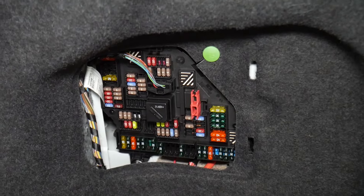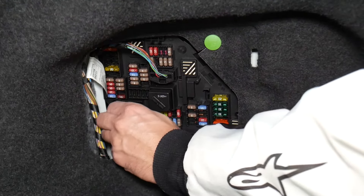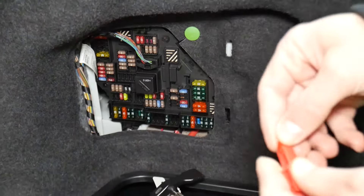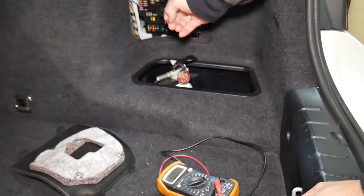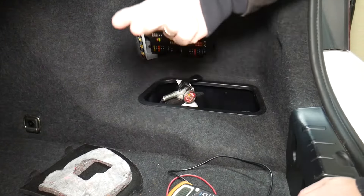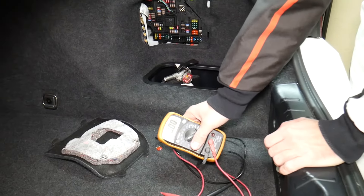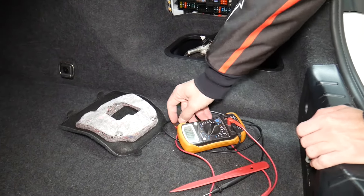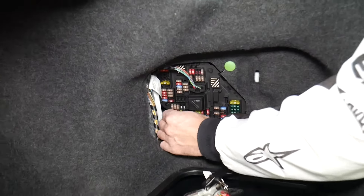Before we continue, let's explain quickly why it's always a good idea to test fuses and relays. Fuses are sometimes really hard to know if they're burnt or not. For instance, I'm going to pull one fuse here — sometimes you cannot clearly see if it's good or bad. If you think you have a good fuse, you put it back in, and you end up having problems again. You spend time and money, buy parts, pay for diagnostics and services that you don't need. So always test your fuses — that way you don't waste money. It even happened to us, and we work on cars all the time.